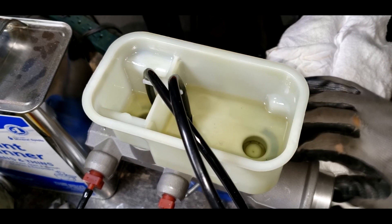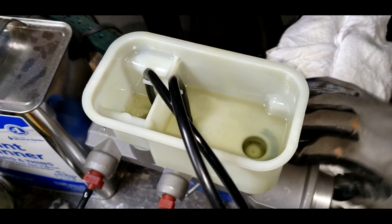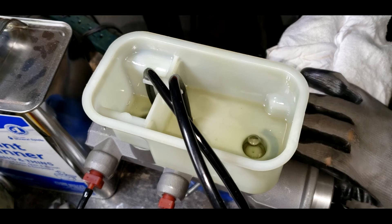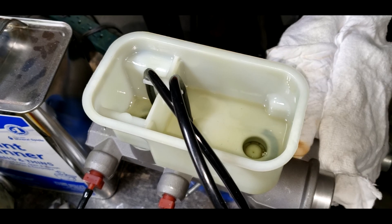It's working. For all the homework I've done, you just keep on doing that — pumping it until there's no more bubbles left. My thumbs are starting to hurt. So I'm going to do this a few more times, cycle this a few more times. I might add a little more fluid because I see it's going down.